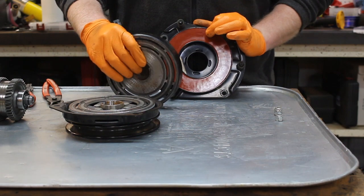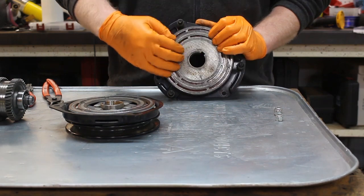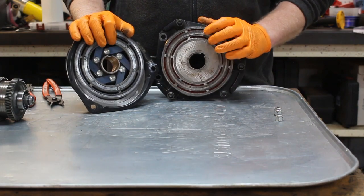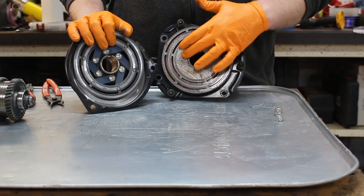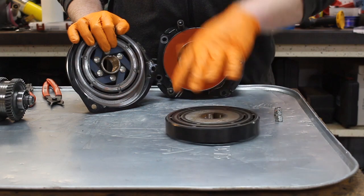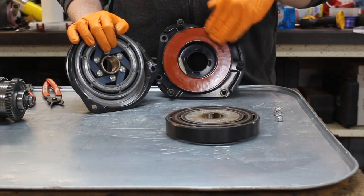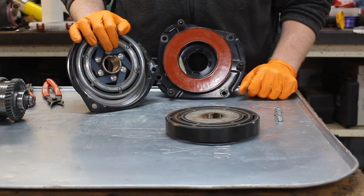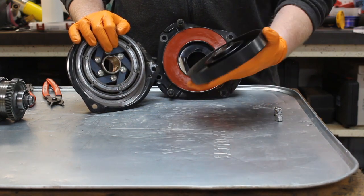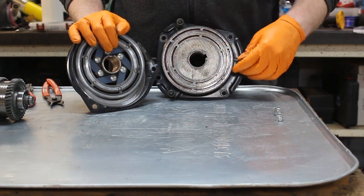This right here is the coil. The coil is where the electromagnetic force is generated from. The reason you have a coil and then the clutch plate over the top of the coil is because if the clutch plate directly contacted the rotor, or directly contacted the electromagnet, you would literally wear off the epoxy so fast it wouldn't even last a minute. One of the biggest things you see over time is this epoxy will wear off, and it will actually wear into the epoxy face.